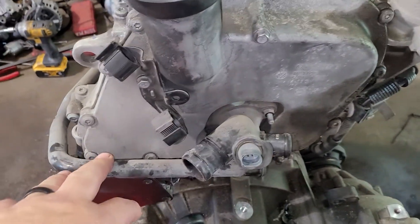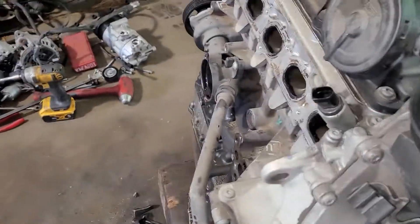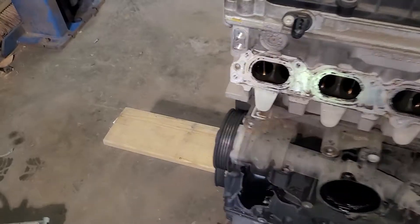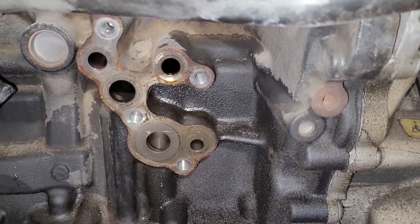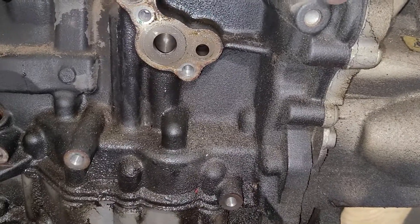The water outlet housings appear to be the same, the water pipe appears to be the same, the thermostat housing appears to be the same, and the water pump appears to be the same — everything appears to be the same. You can see the CBU code on this motor too. Multiple sources have told me you can use it and there are no issues — you just leave the solenoid on there. I don't even see a provision on the block for where it would have gone on the Golf; there's not even a boss on the block, which is strange. But they're guaranteeing it's going to work, so I guess we'll find out. If you're getting anything out of my videos, hit that like button and subscribe — have a great day, keep wrenching!